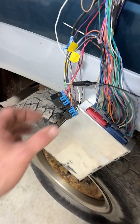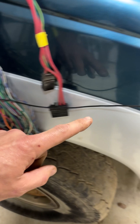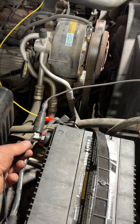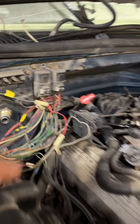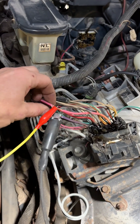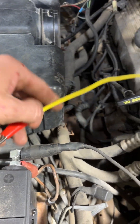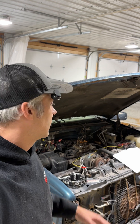Let's hook it all up. We've got our two key-on hot wires — I have them stripped back together with a jumper wire that I'm just going to run up and connect to the positive side of the battery. Technically that's constant, but when I disconnect it, that acts as key-on hot — so that will work. On the other side, make sure we have our orange wire that goes through the loom up to our bus bar — I know I have constant power there. And then I've got my jumper wire going from our big pink wire to our coil — the yellow lead — which I'll hook up to the battery to supply constant power to the coil so it fires up. So we have power where it needs to go and everything should power up.